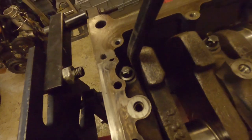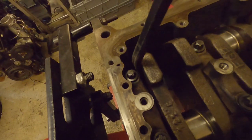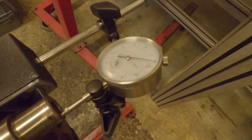You'll find even just touching it makes it move, so you need to be very careful to get it right, let go, let it settle, and make sure it's definitely on zero. Then very gently, use a pry bar between the main cap and the crank — making sure you're not touching any bearings or anything sensitive — and apply a light bit of force by pulling back on the pry bar to see if you can make the needle move.